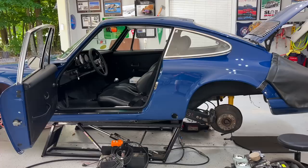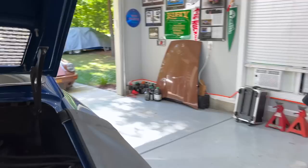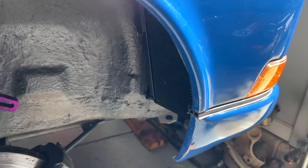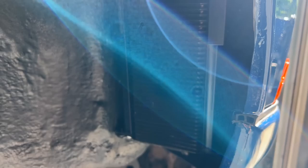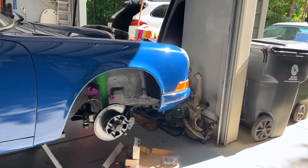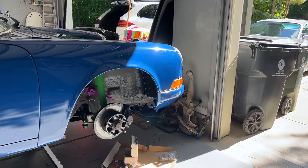On the other side, I started working on the oil cooler setup — that's another thing we're adding. This 2.8 has a built-in oil cooler on the engine, which is okay, but really not suited for super spirited driving, especially here where it gets quite hot and humid. The car was built in New England so it was probably sufficient there, but not here. So we've added a 44 row cooler up front, which I managed to weasel into the front fender area without having to cut the battery box out.